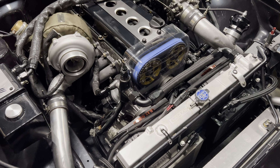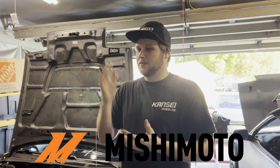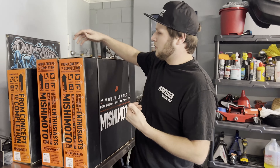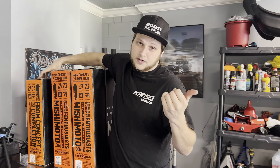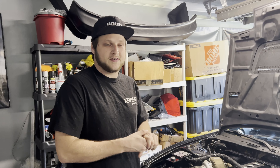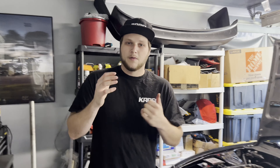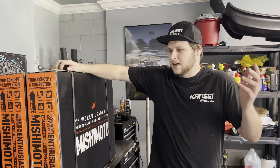It is the next day and the new radiators have just showed up. New sponsor for 2022 - Alberto put me in touch with Mishimoto, and Mishimoto will be on board for 2022. We have brand new radiators here: their new SR20 X-line triple core, their normal SR20 dual pass radiator, and a fan shroud kit I probably won't be using for this car. The Koyo inflow radiators actually aren't very good for track cars without a proper swirl pot - you can get air pockets with the way it's designed. With really good fans like the ones we just installed and a dual pass or triple core it will do much better with temps.